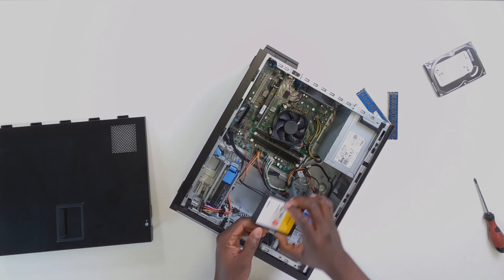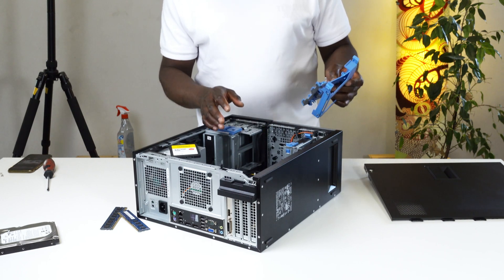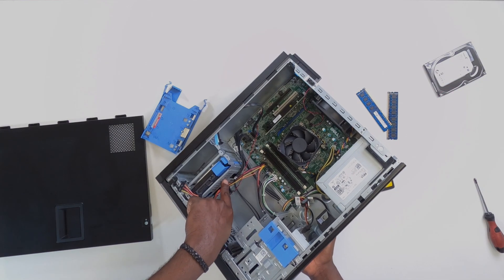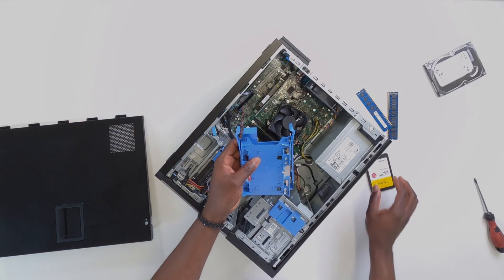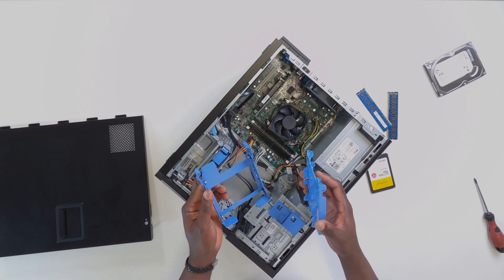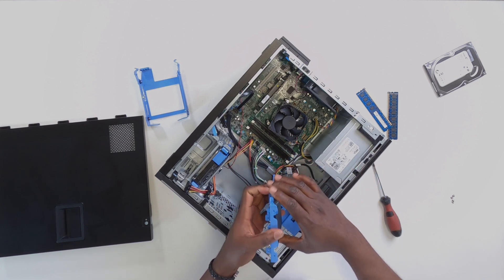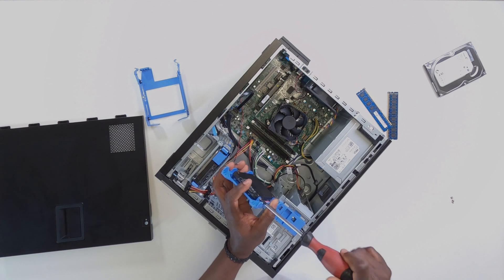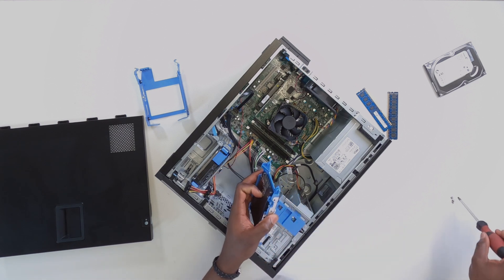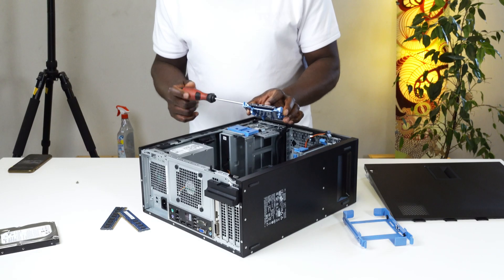Given that we also have to install an SSD on this PC, we'll definitely be needing an additional hard drive holder. This is the best way to do a neat job. I've got videos on this channel of me just installing the SSD directly on the chassis, but using the SSD or HDD holder is the best way to go. It's pretty cheap — I got this off Amazon and I'll be leaving a link in the description. To start, we have to screw the SSD to the holder; it typically has four screws, but two or three will also hold it firmly in place.